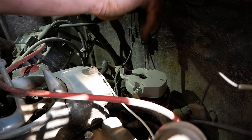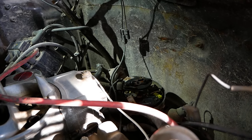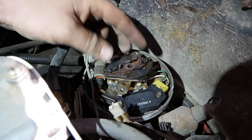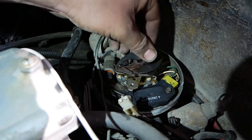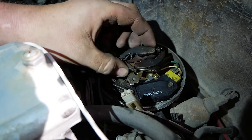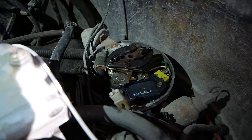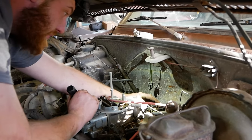The cap wasn't even bolted down all the way — that's good. Looking underneath: the weights are literally on top of each other right now. This is why I don't like stock aftermarket HEI distributors — these shitty cam and weight designs. What's happening is you speed the engine up and these weights are supposed to swing out easily to advance timing, but they're not. They actually retard your cap when they sit like this — absolutely no ability to move your timing.